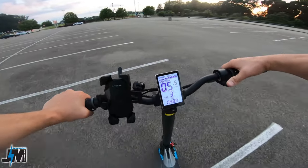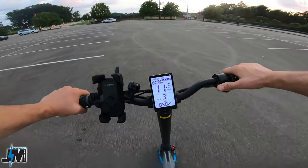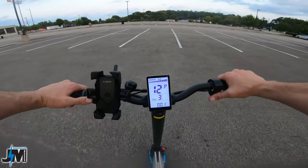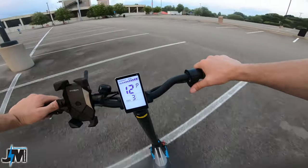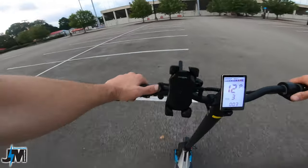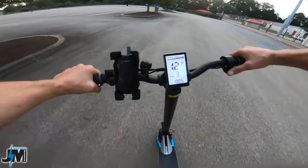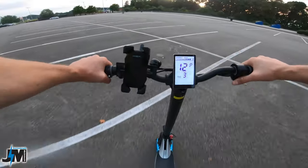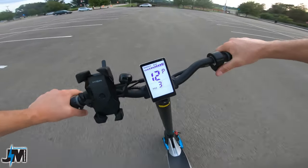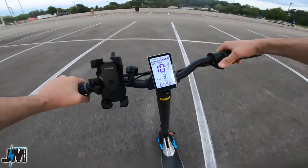They don't recommend this in the manual — it says do not adjust — but you can go into the P settings and adjust your P12 setting. Do this at your own risk. It comes from the factory at level 1, giving very smooth but not very strong pickup. I felt level 3 was a pretty nice balance — still smooth yet pretty quick. Level 5 throws you back, definitely a lot of power out of the hole. Level 3 is perfect in my opinion, but again they tell you not to change it.